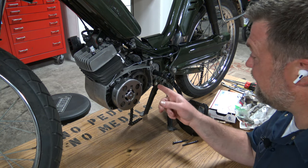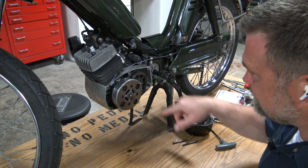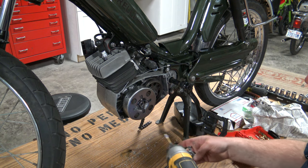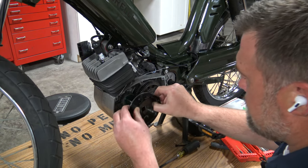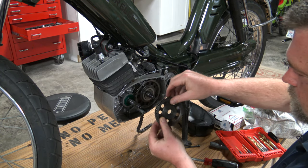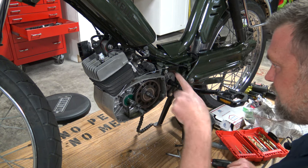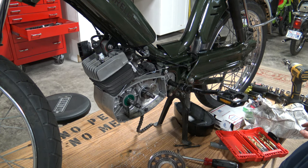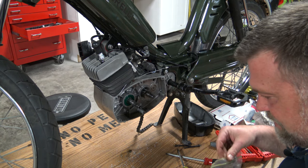It bears saying that I never found the other gear tooth — I only found one, and there's two missing, so I'm hoping I find that at some point during this disassembly. I have to clean this out real well; I've got nasty metal shavings everywhere. There it is. All right. Let's remember exactly the way this goes in — round side going towards clockwise. I still don't see this other broken tooth. I wonder if it was in that oil that I drained out. This is actually the first time I get to make sure that these are exactly the same.